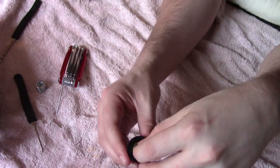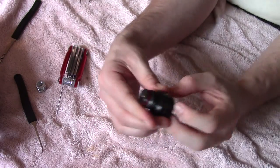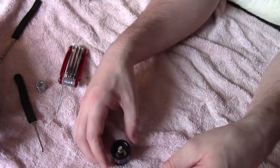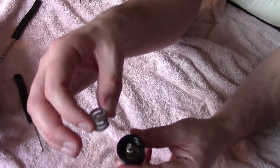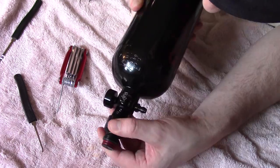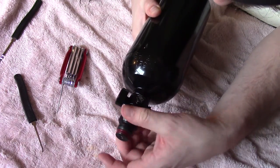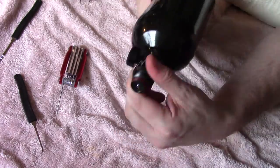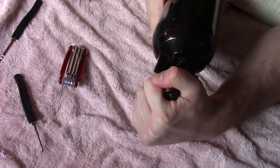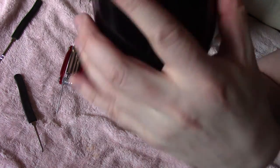As you can see, the ball bearing's in that little hole there — make sure it's snug. Next, put the spring on it: just drop the spring in place, then line it up with the tank. Make sure you don't cross-thread it when you screw on the top. Then you've got to put those two little screws back in. There's one hole right there and one on the other side — just two of them.